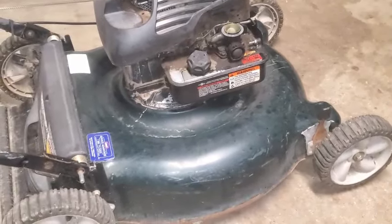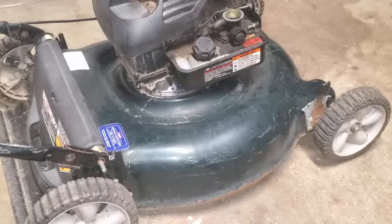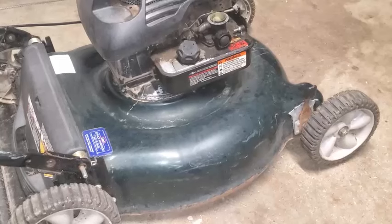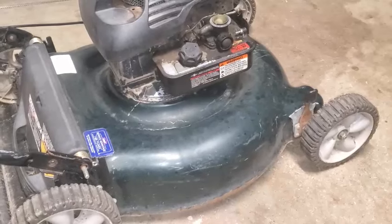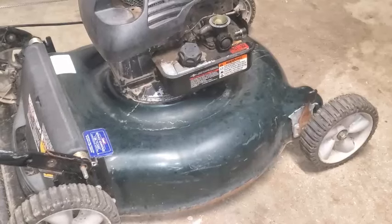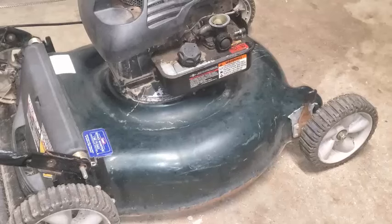And what's just my concern now, I think it's going to run. Depending on the diaphragm, if it's any good, will determine if it stays running or not. And then if it does stay running, the RPM, the out of control RPM. So I think all we would have to do on that is adjust that spring up there on the carburetor that goes to the carburetor, a butterfly valve. We'll probably have to adjust that spring a little more to get it right at the correct RPM.